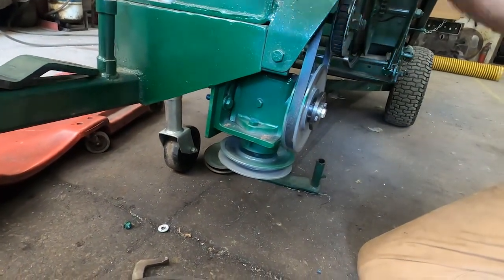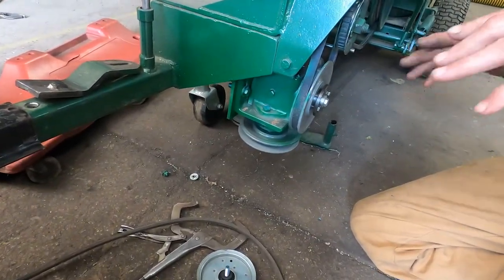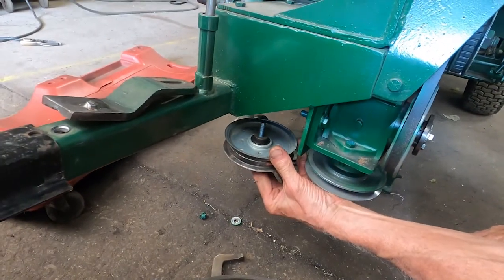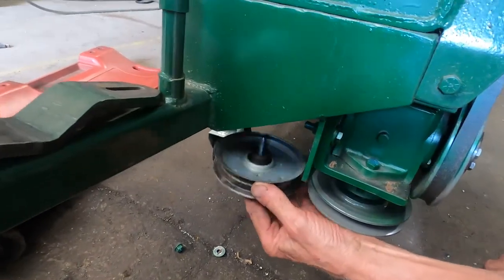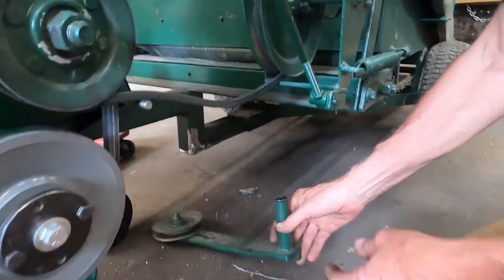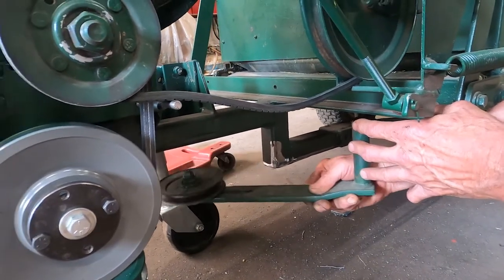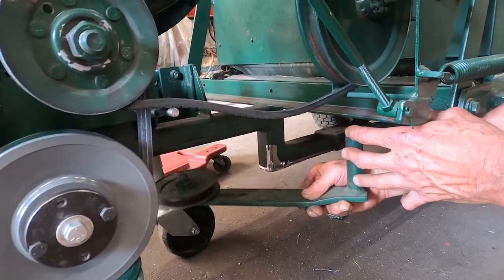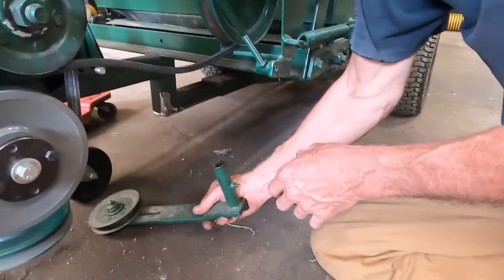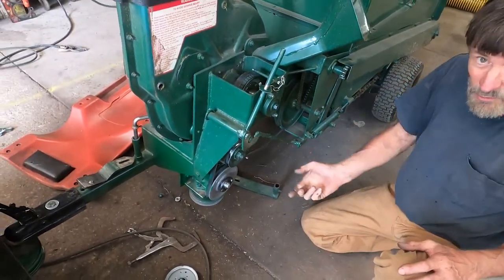Because as this machine pivots, the belt has to be kept tight. There's going to be an idler mounted right about here — this will be a stationary idler with a slotted hole so we can make some adjustment. And then the tensioner idler will be mounted back here on a pivoting shaft with a spring on it, so this idler can slide back and forth. That way it'll maintain tension on the belt when you turn the mower. It's got to have some give to it, so when you turn, your belt gets shorter and longer — it's got to be able to take up that slack so it doesn't throw the belt off.